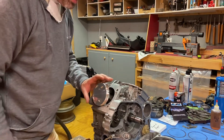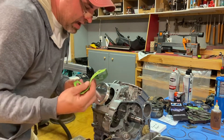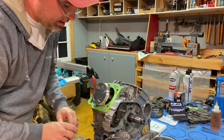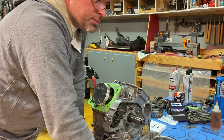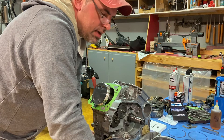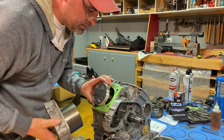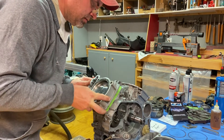I've already got this rear cylinder at top dead center and I'm going to slide the gasket on — this is the thinner of the two that you'll receive. Just make sure your water jacket openings and everything matches up. Also, let me back up: when you're checking your piston ring gaps it's a good idea to rub some motor oil or spray the inside of the cylinder with WD-40, and I also sprayed the outside of the jug with WD-40 so when I slide it down it doesn't scratch or mar anything. The piston rings aren't on the pistons just yet — we're just checking your deck height. I'm going to slide this on.